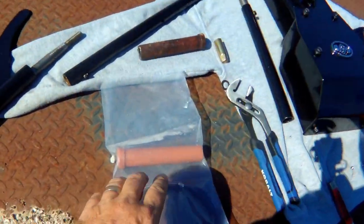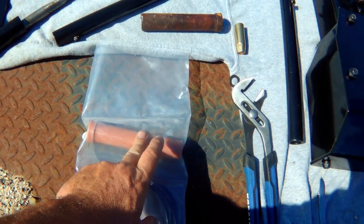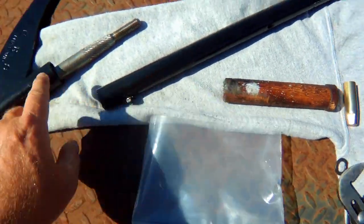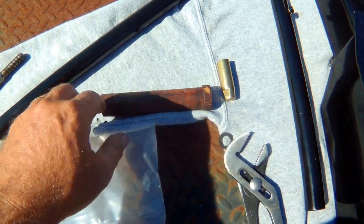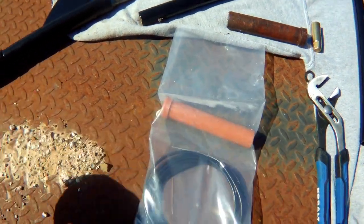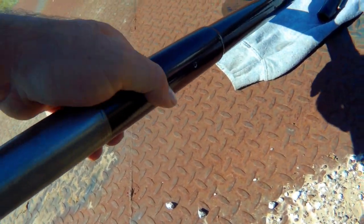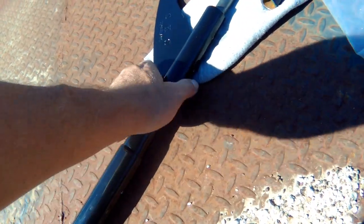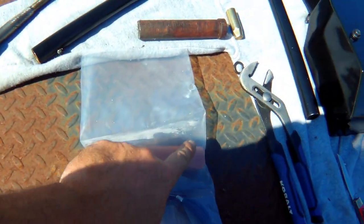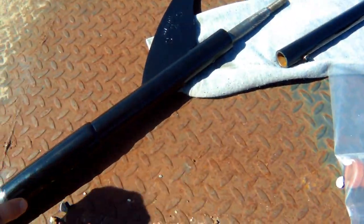Something I wanted to cover: I ordered an extra nylon bushing. I figured it'd be loose in the box, but I went to put it on and there's a wooden bushing in here, and I don't like that. Everything I've seen on a lot of the mud motor forums said these wear out real quick anyway, and that's why I went ahead and ordered this. The way you do that — there's three screws on the top: one in the back and two up front by the prop. They're coarse thread with a real sharp point like a wood screw. I'm gonna put a little grease on that and tap it down in there, then put the screws back in.